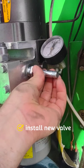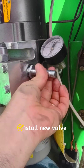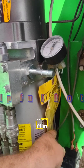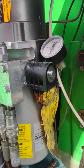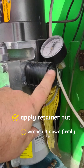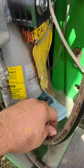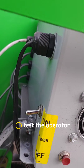Keep it clean and try not to get any debris in there and contaminate the hydraulic fluid. Slide that into the valve assembly and reseat it. Just reverse the process — slide the solenoid back over that pin and put your retaining nut back on. Don't over-torque this nut; it's just keeping it in position. It's not like you're torquing down the head to an engine block.